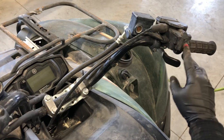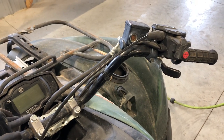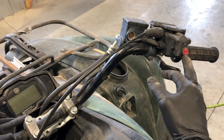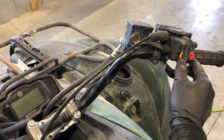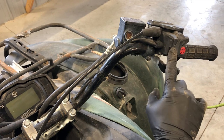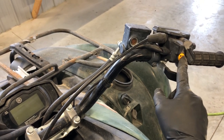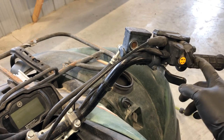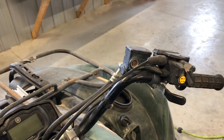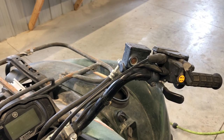We've got your four-wheel drive over here on your right hand side — it's a click button and you can put it into four-wheel drive while you're going. I don't suggest spinning your tires while putting it in four-wheel drive, nor do you want to be going very fast. For differential lock: in two-wheel drive you won't be able to push the lever over. Push it to four-wheel drive, push that red knob down, flip this over and four-wheel drive is engaged. Then to put it in differential lock, hit that yellow button. It won't allow you to switch back while going down the road or spinning your tires. Make sure the tires are barely straight when putting in differential lock — if you're spinning or tires are really turned you can cause some damage.